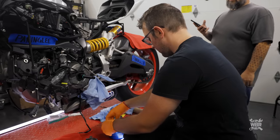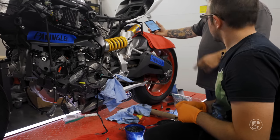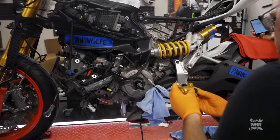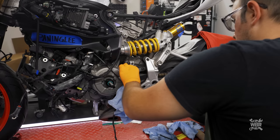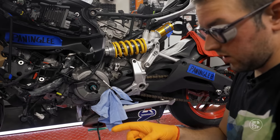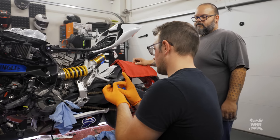I can go ahead and put grease on the slave cylinder piston before slotting it in. It goes in like that with the flat piece oriented correctly. It mates with the other side like that, going inside it. The reasoning for putting this on first was because it was hard to get it threaded on since it would rotate. Now that the piston is placed inside, the o-ring is going to stop liquid from coming out — just make sure it fits into the notch. The lubricant needs to come over the o-ring.